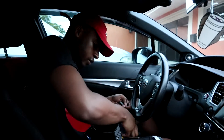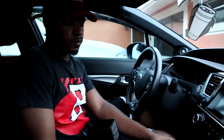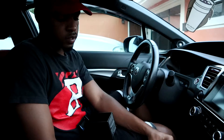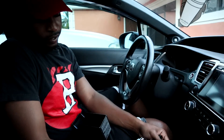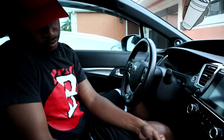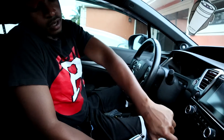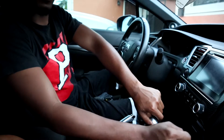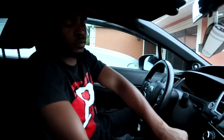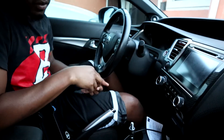For 9th gens, basically all you have to do is unscrew it. Once you figure out how to get this down — I don't know what size it is, I think this is a 10 — yeah, I think you use a 10 to hold this nut right here, and then you push the ratchet one way and twist the shift knob the other way and it should break it off, then just spin it off like that.